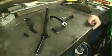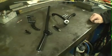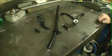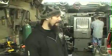And these are just a bolt-on kit. The only thing you have to customize is your own clutch cable, and you'll be utilizing the shift lever from your forward controls. These kits only work with forward controls, but you could probably customize them to work on a jockey shift. The kit also comes with all the hardware that you need to bolt all this stuff together.